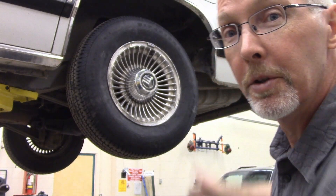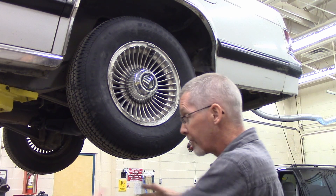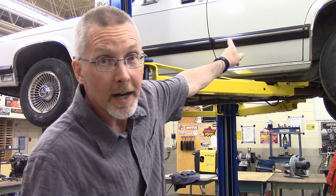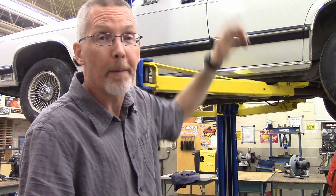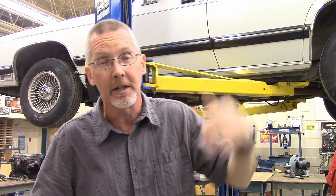You don't have to put the hoist all the way up — put it to whatever height is comfortable for what you're doing. Maybe you're changing headlights and have a bad back; put the headlights up at a good height. For brakes, I'd put the wheels at a comfortable height. Good idea to always leave the doors closed when it's going up, so it doesn't catch on anything. Don't have anybody in the vehicle when it's up there — we don't need that dynamic shifting weight that could upset the vehicle and make it fall over.